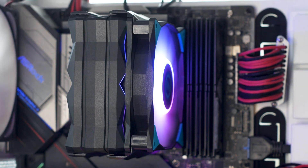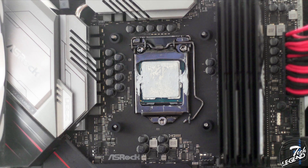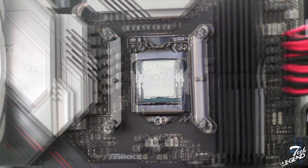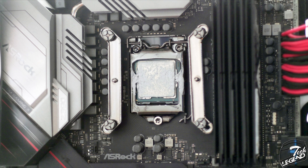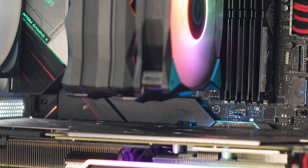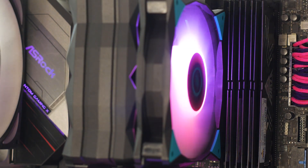The installation system is simple and robust. You first get the backplate and adjust the blue sliders to fit your socket, then place it on the backside of the motherboard and put the plastic spacers on the front side. Afterwards, you install the mounting arms and secure them with the thumb screws. Finally, you apply thermal compound on the CPU surface, place the heatsink over the mounting arms lining up with the pre-installed spring-loaded screws on the heatsink, tighten those up, and you are done. What's left is installing the fan on the heatsink and connecting everything to your motherboard.